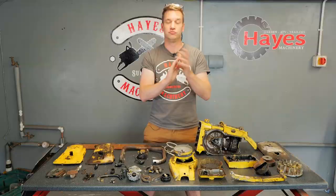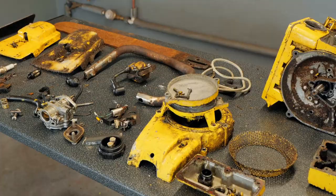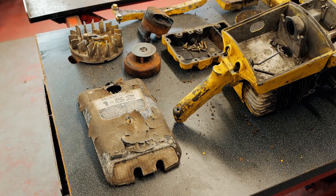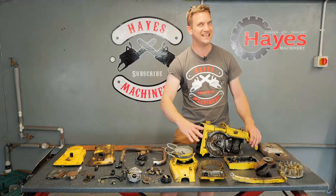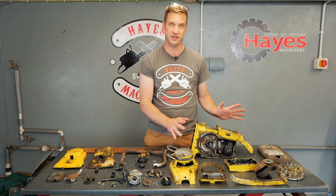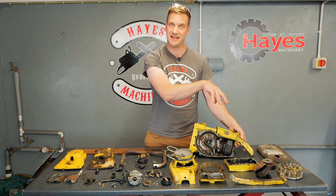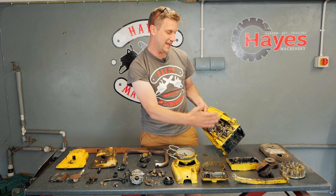We've got it down to a few hundred pieces. I'm quite pleased with how it's all come apart, although I had to get the old hammer and cold chisel out on a few of the bolts on the front of the petrol tank. I haven't taken everything apart yet - we're going to give it a clean down. The cylinder, piston and crankcase are absolutely fine. My biggest concern is if we strip this further there are actually four more gaskets in there: one from the inlet manifold coming off the carb into the reed system, one on the fuel tank going back onto the crankcase, and one on top of the cylinder. My biggest issue is I'm not going to be able to get genuine gaskets for those. Doing one on the front of the petrol tank is quite easy, same with the oil tank on top - absolutely fine. If I've got to use gasket sealer I will, but we should be able to make a gasket for that.